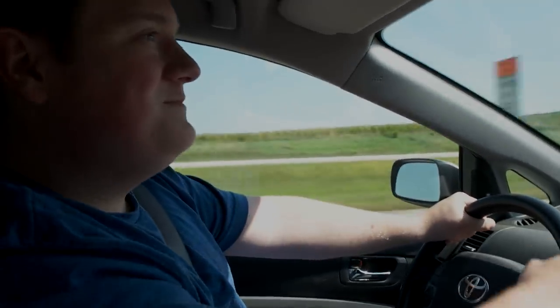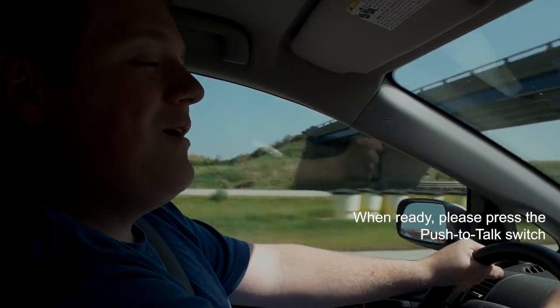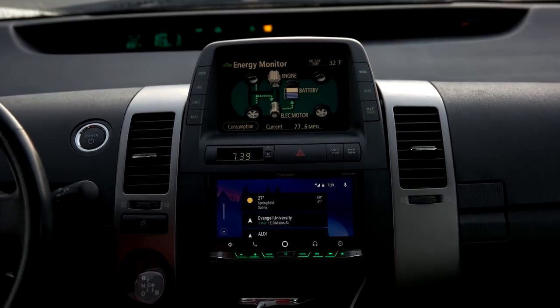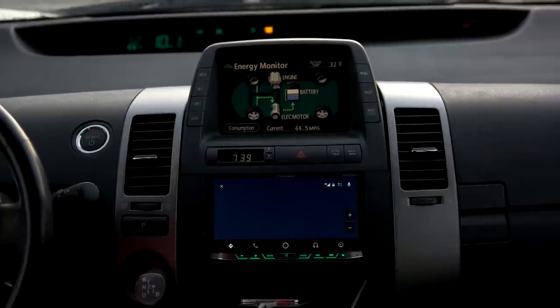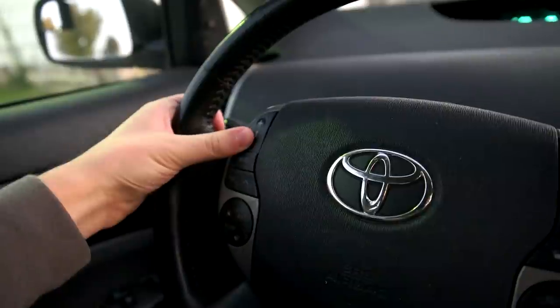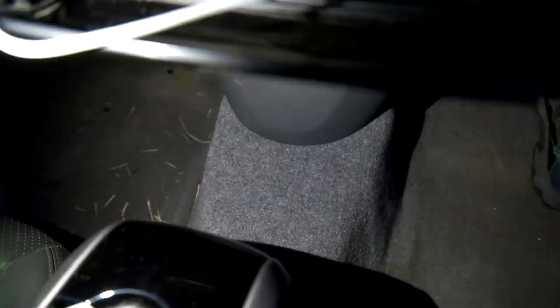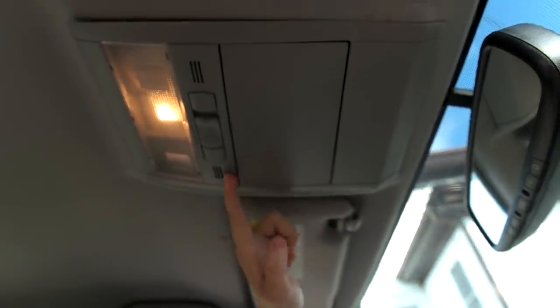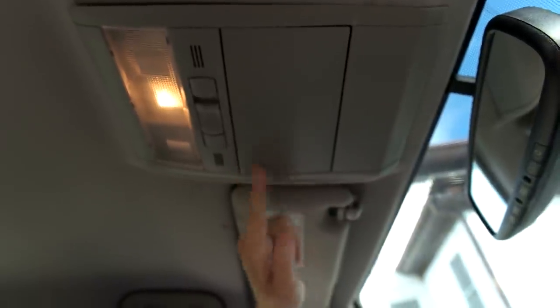Is there a Walmart nearby? We gotta get a new radio. Things don't work right. So to update the severely outdated navigation system, we'll be installing a head unit that has Apple CarPlay and Android Auto. We'll be able to retain most of the steering wheel controls, run USB extension cables and an aux cord into the central compartment, and tap into the microphone in the ceiling.